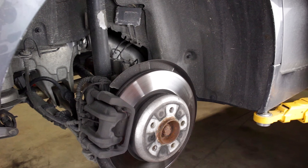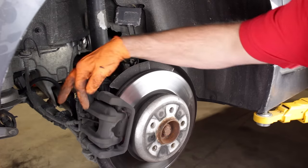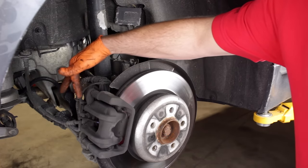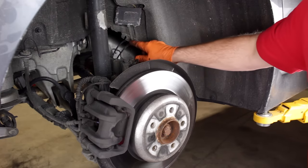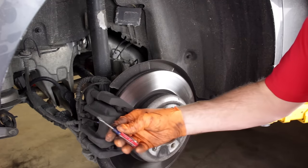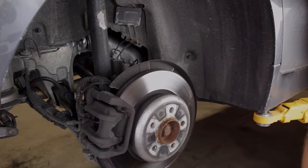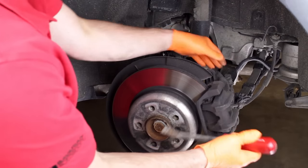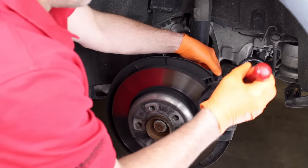We're performing this procedure on the left rear brake assembly. The right side is the same except for the brake pad sensor wire. On the right side, dismount the wire from the various mounting points and unplug the harness plug inside the connection box. Once the caliper is removed from the bracket, you can remove the inner brake pad and use a screwdriver or a small pry tool to pry the sensor tip from the brake pad.